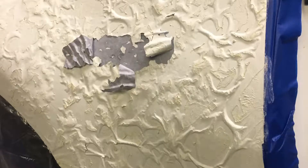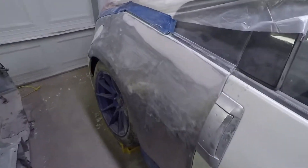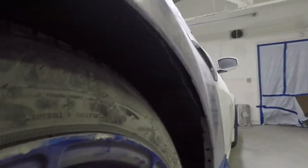I'm going to show you guys a picture of what it looked like. Basically, what I ended up having to do was to completely remove all of that nasty paint, and I ended up completely sanding all the way down to the bare metal. I'm going to have to spray primer - it's back down to the bare metal. I ended up doing some bondo work right here, body work, making it really nice and smooth. When you replace a quarter panel, you're supposed to do the inner wheel well and attach it to the outer skin - I didn't do that. I completely forgot about it. And as you can see up here in the wheel well, my finger can go all the way through in there, so that needs to be welded right back up.